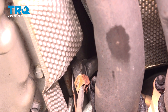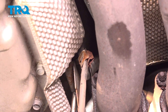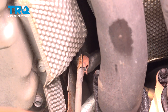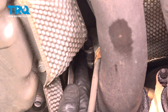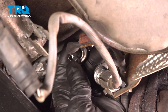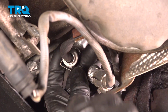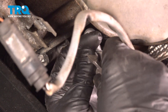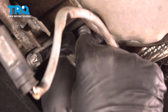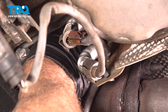There's a bracket up here — just using a pick and a screwdriver to get that out of the bracket. I'm just gonna take some side cutters. There's a wire tie right here, just so we can move the insulation down. Cut that wire tie so we can slide that down to get the tool over the O2 sensor.